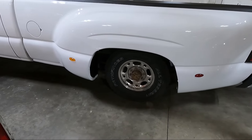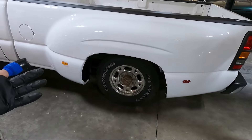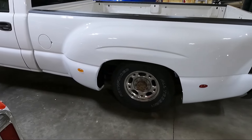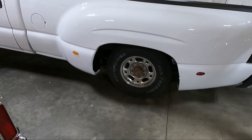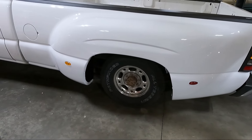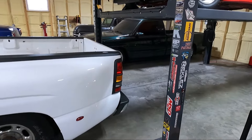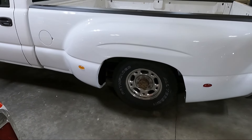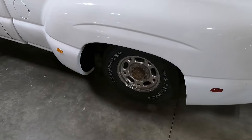I didn't want to do this twice because taking the rear wheels off with the duals is going to be a lot more work than just a single tire. So I'm going to jack this thing up from the rear end, get it supported with jack stands, and pop these wheels off and take a look at what we're dealing with on the brakes. It's a disc brake rear end on this truck, which is nice, and it's a dual disc. Let's get started by jacking the rear end up - I'm guessing that's seven-eighths which is pretty standard. Let's get the wheels off.